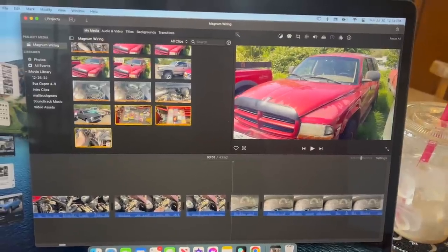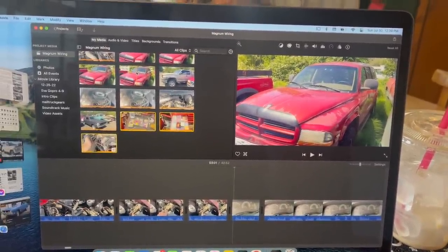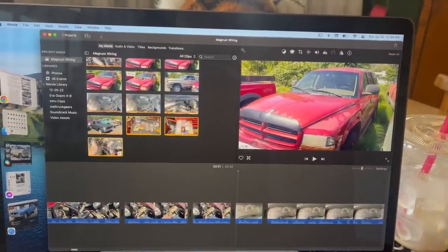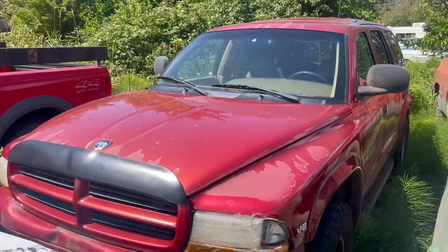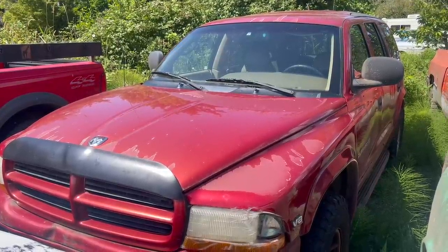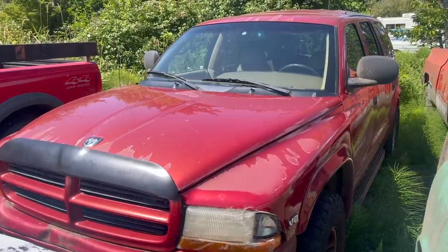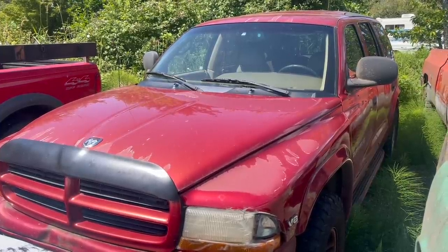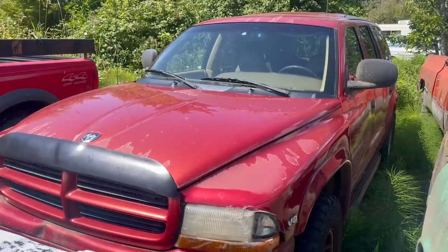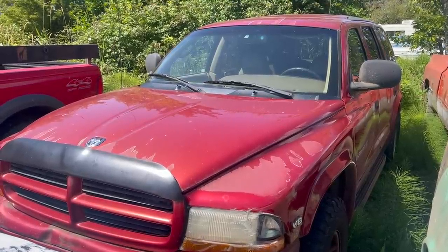As a quick aside, the Dakota pickup and the Jeep Grand Cherokee with these V8 engines are also the same as the Durango. Any of those are going to have the engine harness wrapped in with lighting and everything else. One further note on using Durangos as drivetrain donors, some of them, in some years, have key security. This means that it needs to read the chip inside of the key for it to run. With this in mind, you need to be careful if you want to use a Durango as your PCM donor. You can always go grab a computer out of a truck and use everything else from the Durango, and that'll be fine.